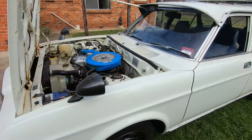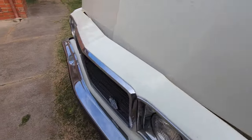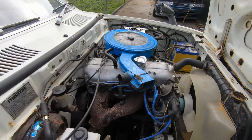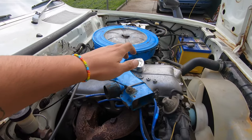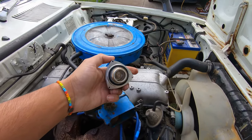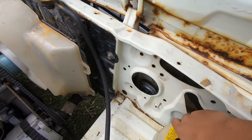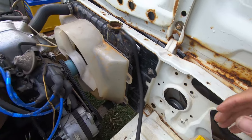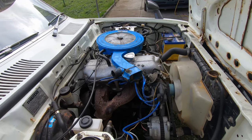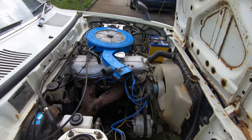This is not the original motor, but a period-correct motor — this is the Mazda MA motor. It's still running points, still running everything. It's got the old milkshake happening and it's dumped all its water into the overflow. It just started two-stroking — missing — and basically just left me stranded. So this is the period-correct driveline, but we're going to pull all this out.